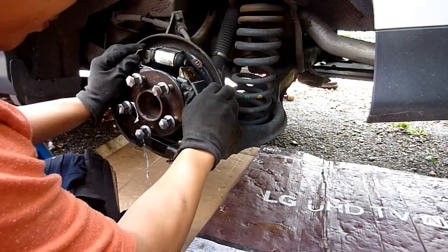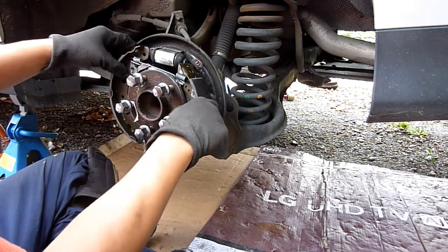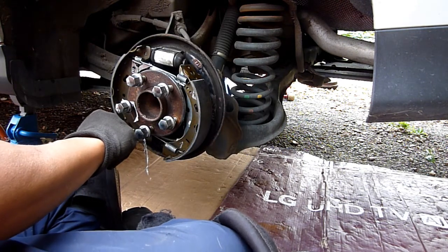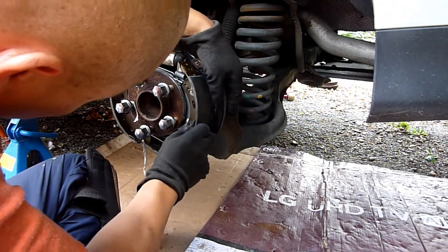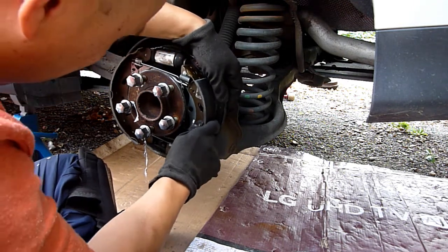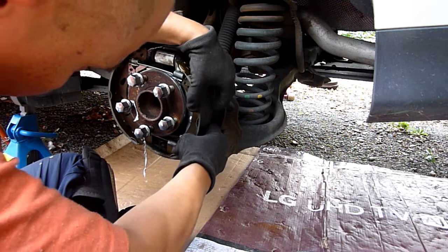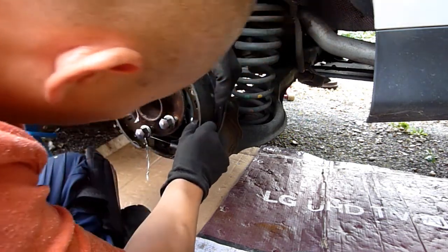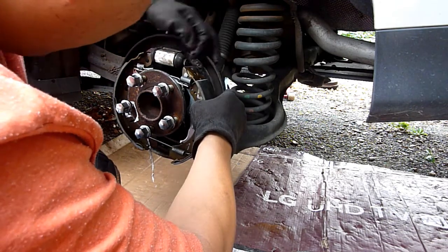All the springs are there. Now comes the job of trying to maneuver it in. Make sure you're not pushing on a piston, because if you push that side, it's going to slide and come off. So, here's my pen. Behind the bottom one. Make sure not to forget to do that. It's been trying to fall out. Push that in there.